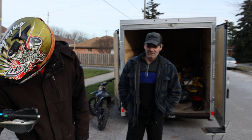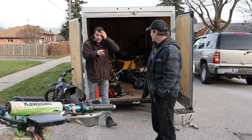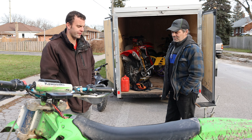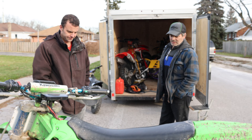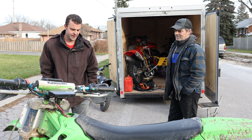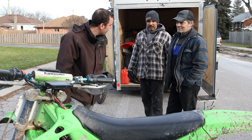I have headlights, all the plastics on it — she looks crisp. As you can tell she's well used in the dirt — it's not babied by any means, I abuse it 100%. The controller is actually right up here where the gas tank used to be — the two shrouds meet and the controller is sitting right there on top of the frame. This was my test bed. I've maxed it out at 9,500 RPMs. Most electric motors top out lower, but with the Far Drive and field weakening I can get 9,500. I've had it topped out over 140 km/h.